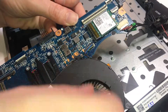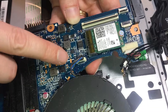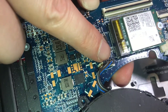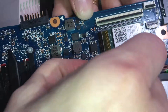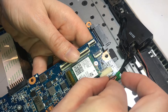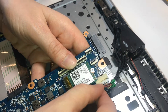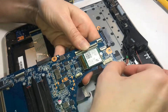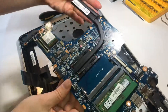The fan will be easier to deal with if we remove it. To remove the fan, pull this plug straight out — the black comes out of the white frame around it. You might have to dig your fingernails under there. This other connector also pulls straight out, and the tabs on the side help you get it out gently. Now we have nothing tethering the board at all.